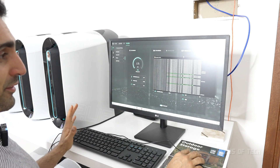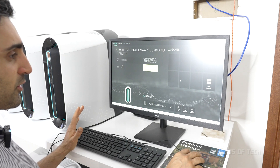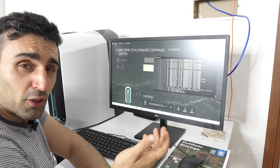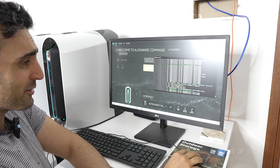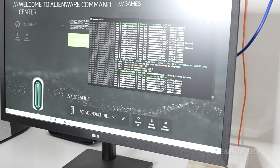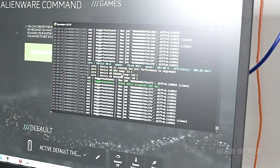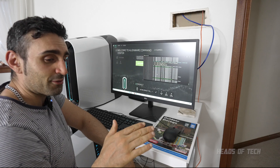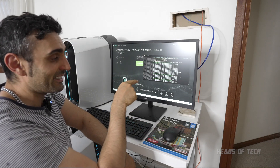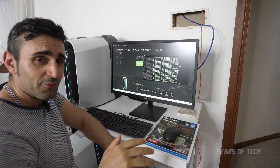If I try mining with higher limits I'll give you a demonstration - I'll turn off overclock. It's going to start mining and you'll see what happens. Look right there - it says 'device is running too hot, performance is degraded'. The GPU temperature is 53°C but the GDDR6X memory temp is 110°C. At 110 degrees on the memory it starts to thermally throttle, so the chip will automatically slow down to compensate.